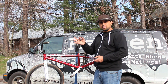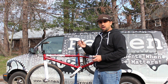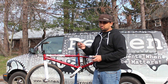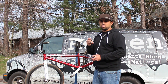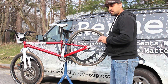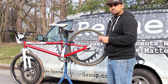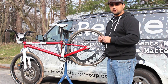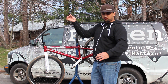There are three magnets inside the Smart Sprint package. Three magnets can be used when you have a 36-hole wheel. If you have a 28 or 32-hole wheel, the maximum you can use is two magnets. We'll produce a different video showing how to set it up on a 28 or 32-spoke wheel. If you're using a 36-spoke wheel, that means you could use three magnets evenly spaced at 120 degrees. I'm going to show you how to mount that and count out your spokes so that you have all three magnets spaced correctly.